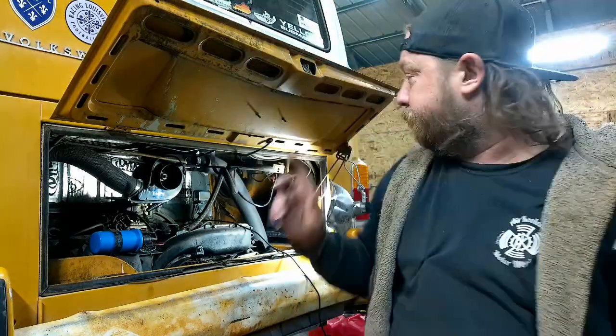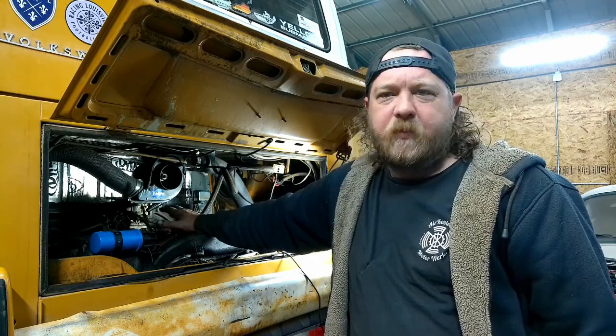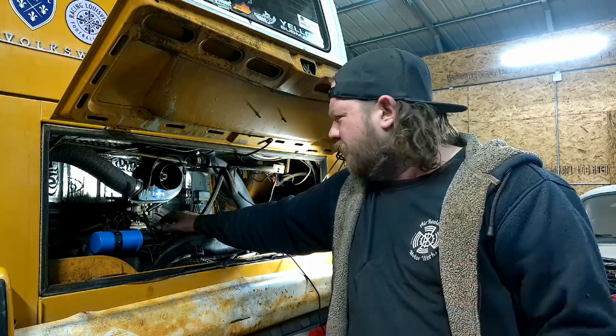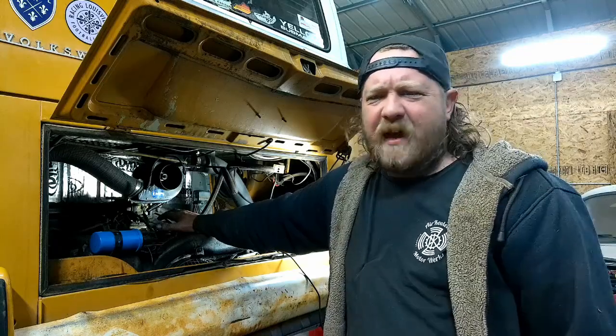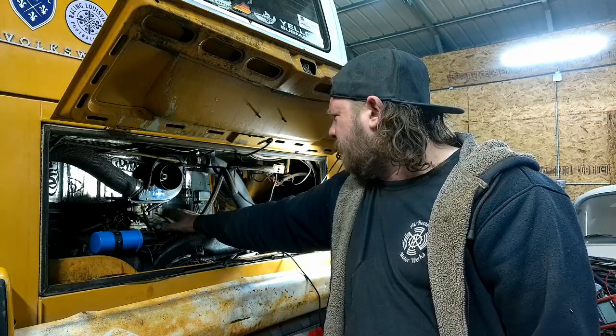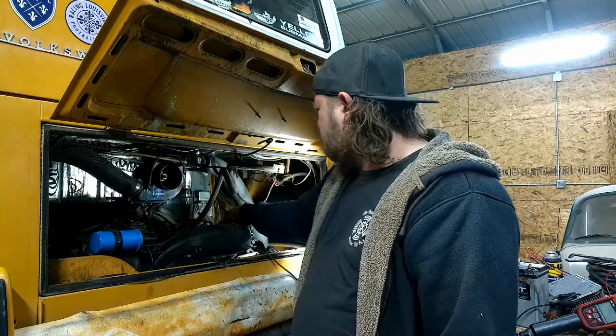So I think I left off yesterday with tuning this car because it was excessively rich. Anywho, I just basically turned it in. The base gasket is leaking some fuel, and there's either a float issue or the needle's just not seating properly. I'll talk that over with the owner, but right now it ain't gonna gas you out of the room, so that's a good thing.